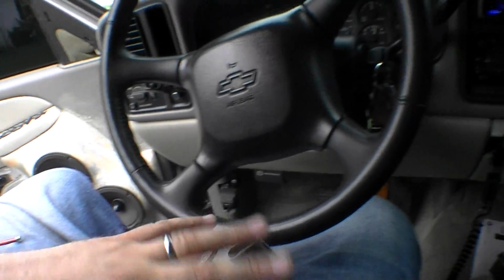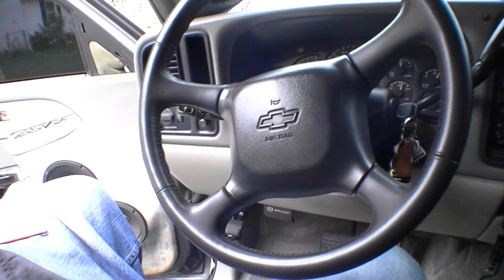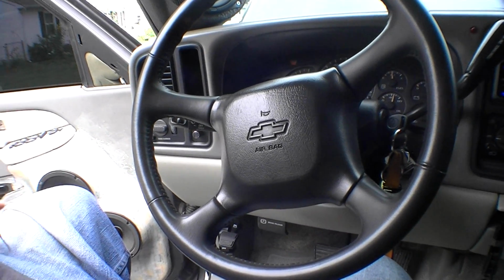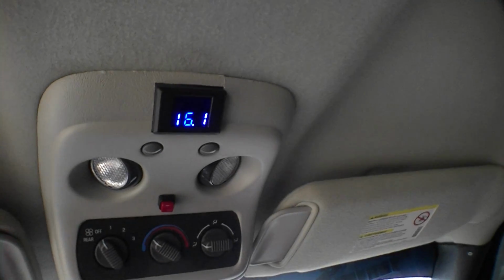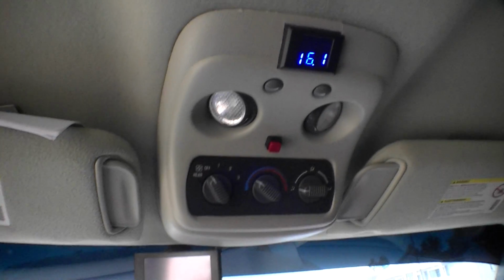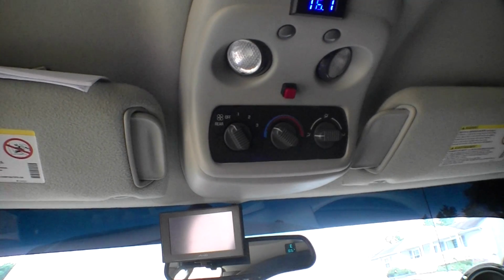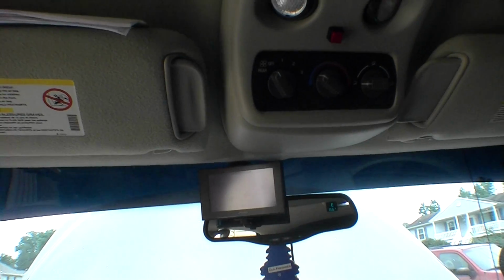Mechman thinks it might be my alternators, but I did actually switch out that second alternator, because I have four 300 amp alternators, but I'm only going to run 2. So I had 2 backups. After I had the problem the first time, I went ahead and switched it out just to see if maybe, hey, shit happens. It could have been one of them alternators. Had the same problem with the other alternator. I guess you could also have 2 bad alternators, but I wasn't going to switch out for a third alternator. I kind of just figured there's got to be something going on with the harness, you know.